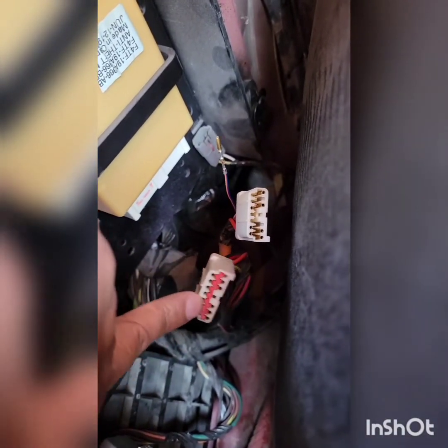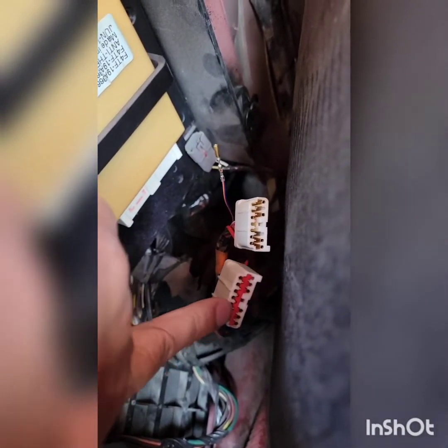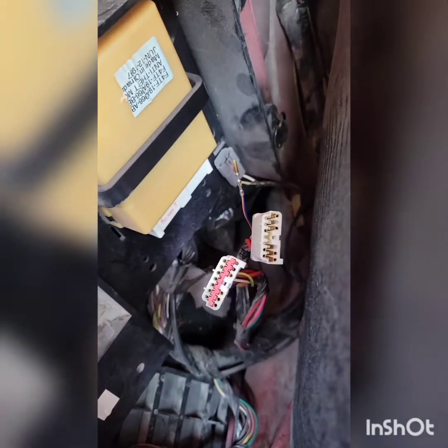In case I do this incorrectly, I can put it back together with no problems — no need to cut the wire and try to figure out how to solder it back in case you cut the wrong wire. That's why I want to de-pin it. Just to make it idiot-proof, I'm going to de-pin the wire on this harness for the trunk. The trunk's never given me any issues, but bypassing the car alarm system altogether is going to make it worthwhile, in my opinion.